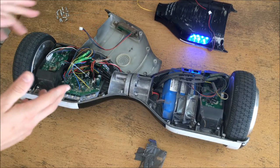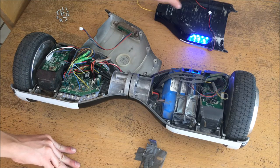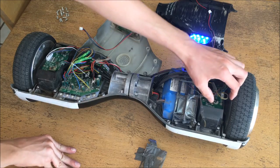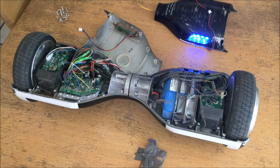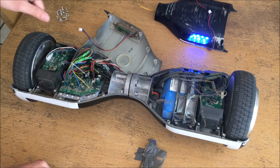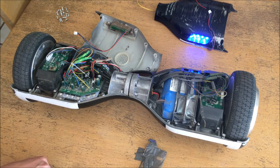I've connected the offending light to the benchtop power supply and it looks relatively stable — I don't see any signs of a problem. This suggests that possibly a loose connection at the board junction connector is the reason it was malfunctioning. Chances are just reseating the connections on both lights will ensure there shouldn't be a major problem in the future.